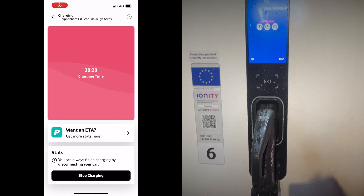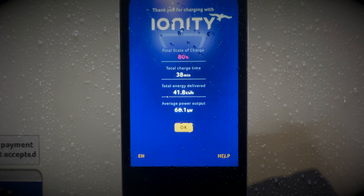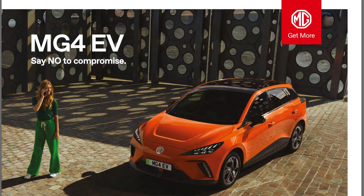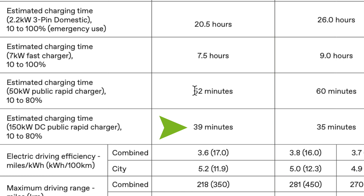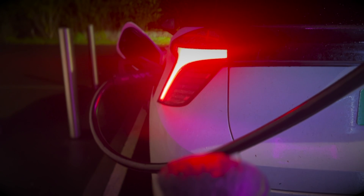We can finish the charge and stop it using the Bonnet app by hitting the stop charging button. Now we didn't get our peak 117kW, so let's have a look at what we've learnt. Looking at the MG brochure, it says a charge on a 150kW DC public rapid charger from 10 to 80% should take 39 minutes. We did it in 38 minutes — but bear in mind that was from 5%. Going back through the data from my video, from 10% onwards it actually took just 35 minutes in total. That's 4 minutes quicker than the advertised time, which I think is absolutely brilliant — and remember, that's without hitting the peak speed we were hoping for.